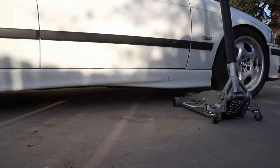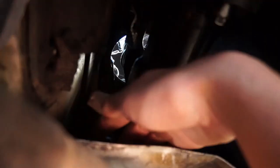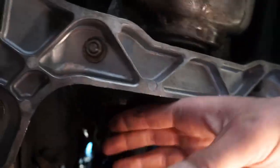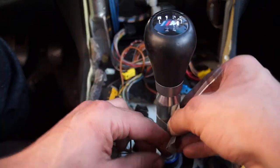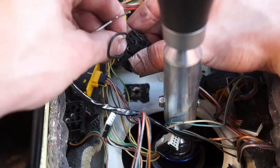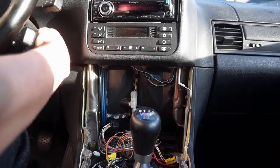We do need to get under the car, so I'm going to be jacking mine up. Underneath the car there's the little reverse light harness we fed through - I'm going to feed it over the cross member, pull it through, and that connector right above the fill hole for the transmission is the reverse light switch. I'll go ahead and plug this into it. Now that it's plugged in, we can take our wires and plug one into pin two and the other into pin three.